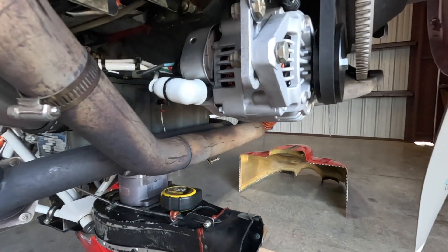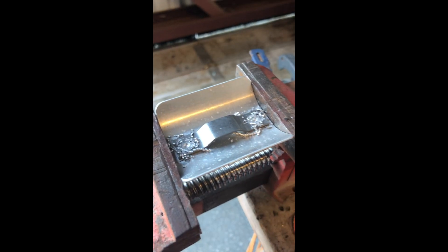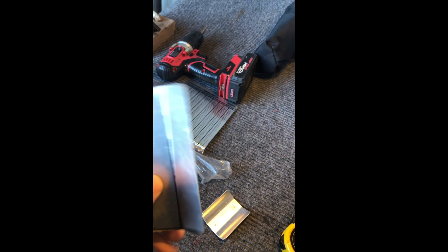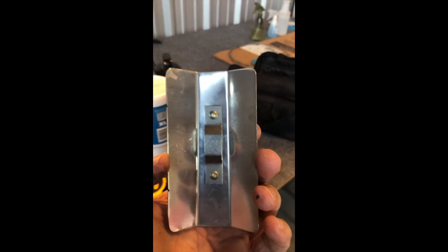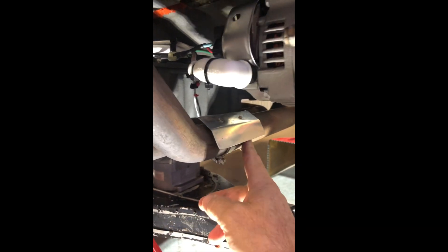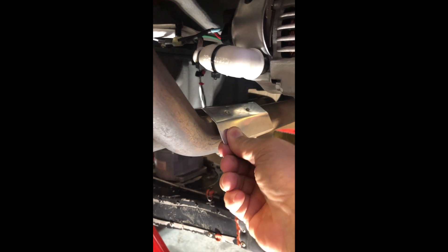As you can see, I've got the heads drilled off the rivets — now let's see if I can get that to pop off. I've got this new one cut to size; I just have to get this metal piece riveted on and we'll be good to go. Let's get a hose clamp in there — there's the hose clamp and the little slot. Hopefully that will keep the temperature — around 1000 degrees or so right in here — away from the diodes and the voltage regulator in the alternator.